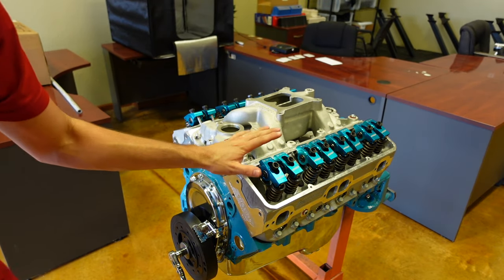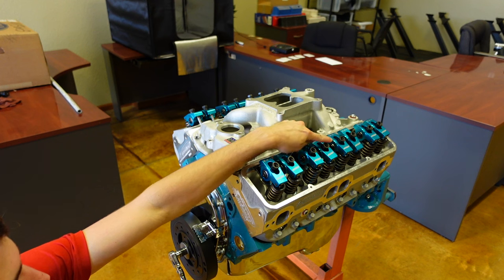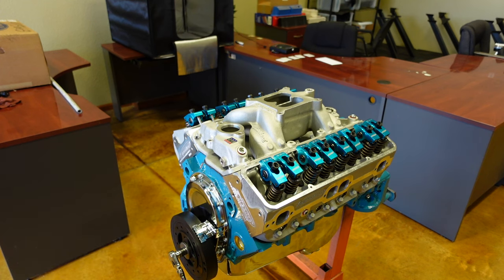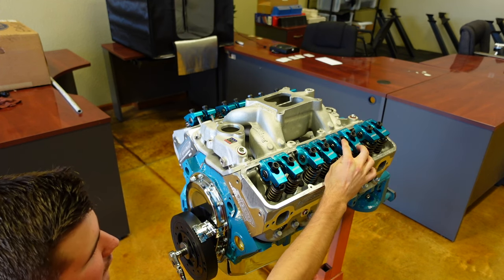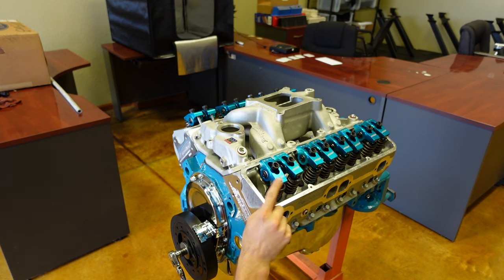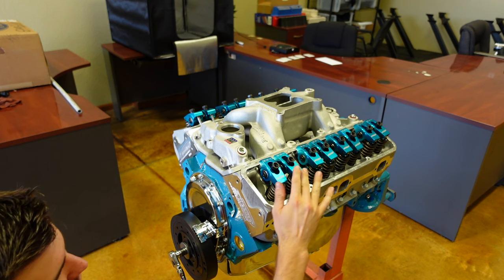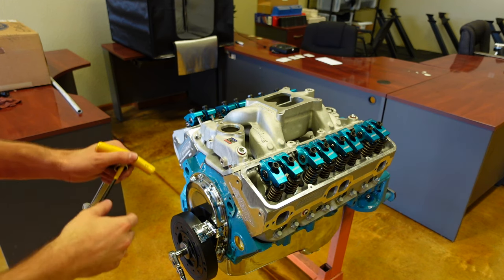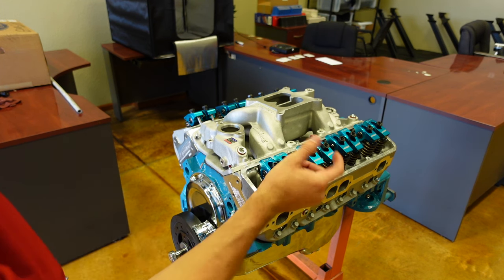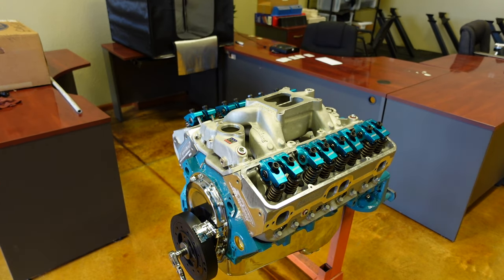What you can actually do to check yourself is come down and look down almost like you're looking down the barrel, and you'll see that all of the very tips of these polylocks should be the exact same height. If you come down here and look, and you've got one that's a quarter inch tall or a quarter inch short, you know you should probably come back and double check that rocker arm. There will obviously be a little bit of variance — I've probably got 20 to 50 thousandths of height difference across the board just due to a stack of tolerances, maybe threads started at a different point. But it's a good quick way to check yourself and go, yeah, these are all set correctly.